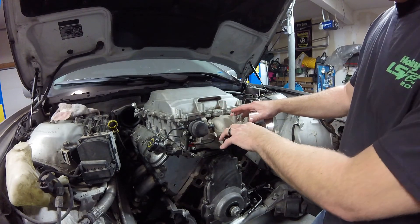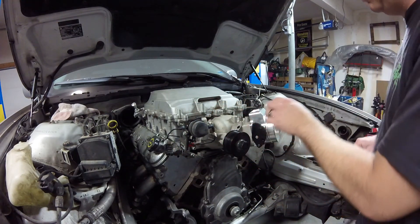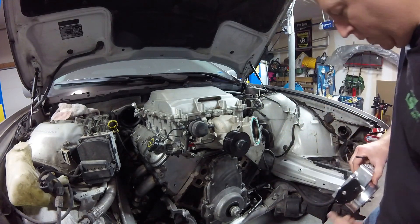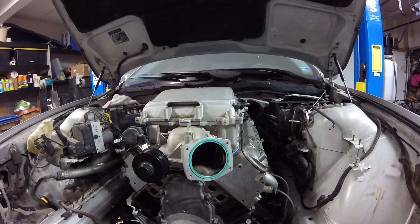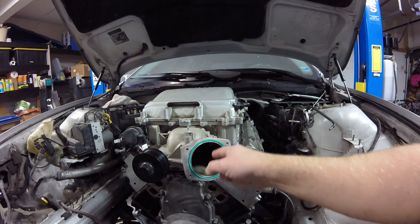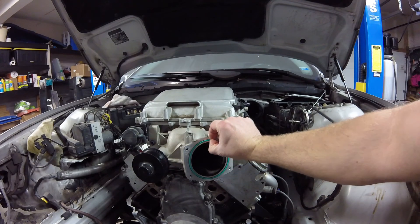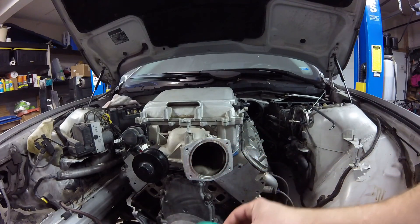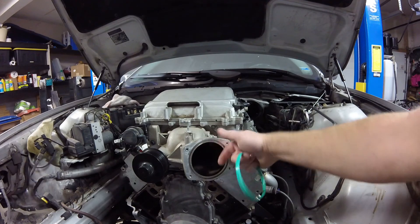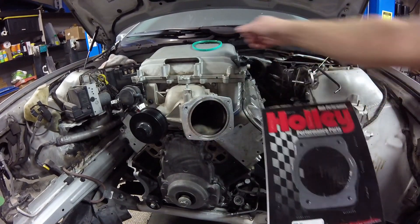In order to port this out, I need to disconnect the actuator and remove a bunch of 10mm bolts around this thing. I'm also going to take the throttle body off. Where that throttle body mounted - when I opened it up - I could see the outside of the gasket. Pretty much I need to open up the opening of this throttle body to the edge of where this gasket would normally sit, because this gasket actually fits inside the throttle body and isn't doing any good. I need to open it up so my throttle blade can open without hitting the edge.